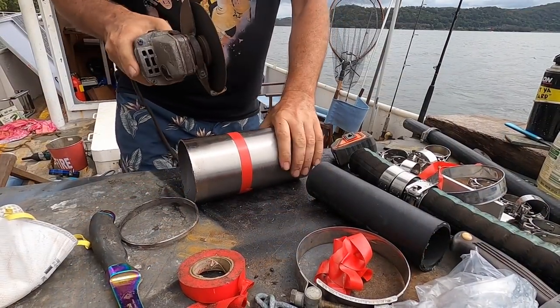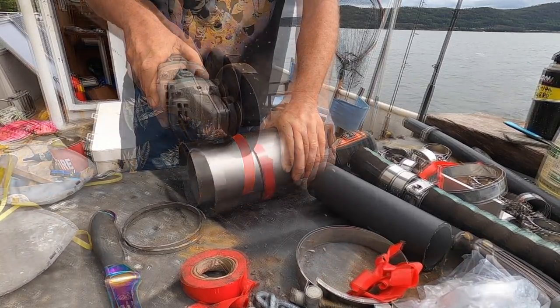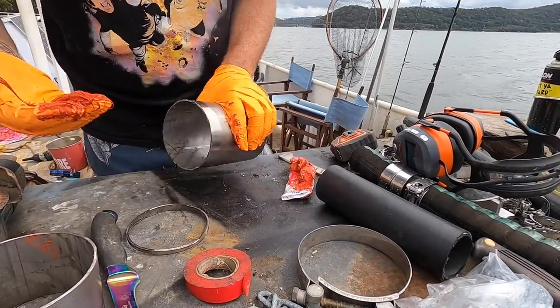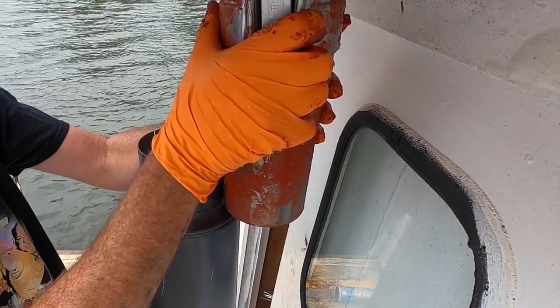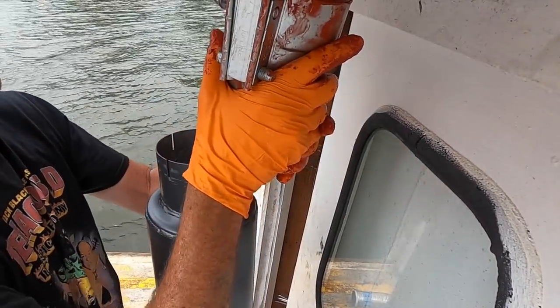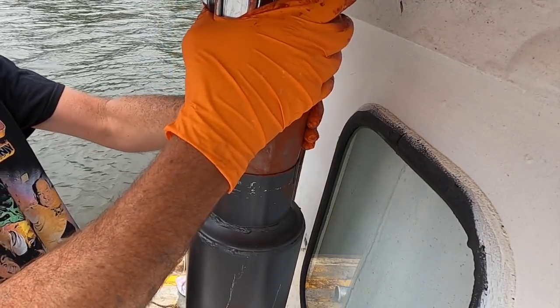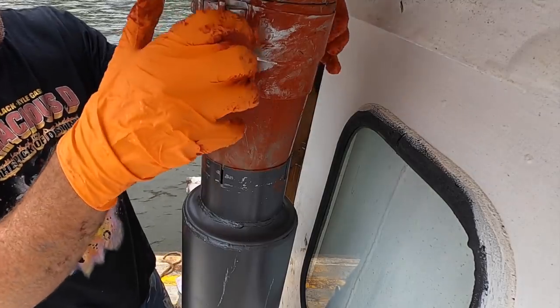After that I had to start fabricating a little sequence of hard pipe and flexible pipe. The flexible pipe is actually a bit of pipe that Damien from Brewpeg gave me when I was up there. Put a big swag of RTV on everything again — most of it went in the joint but a lot went all over the pipe as well. Got it in, just get it all together, then once I got it clamped up I could start to clean it all up. It was certainly a mess doing it though.